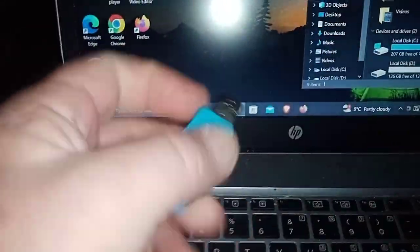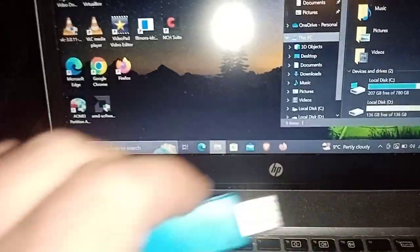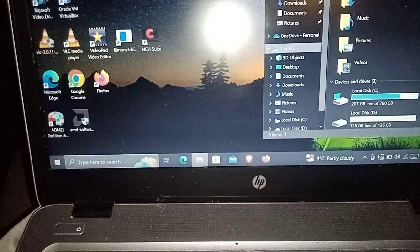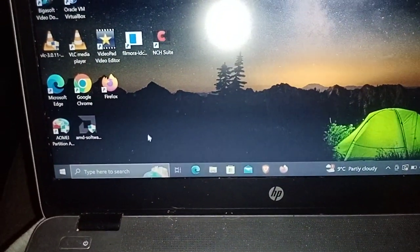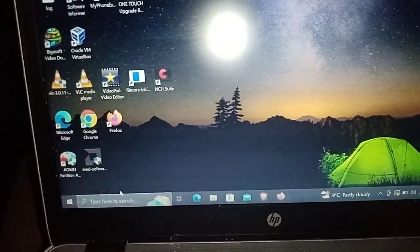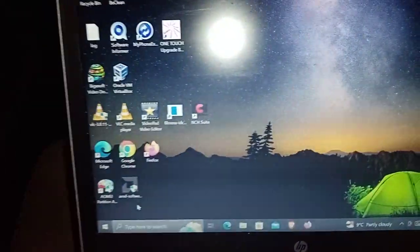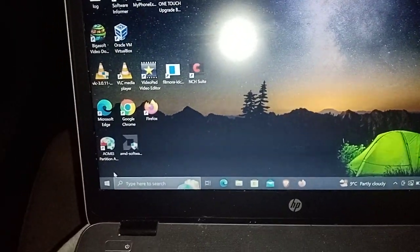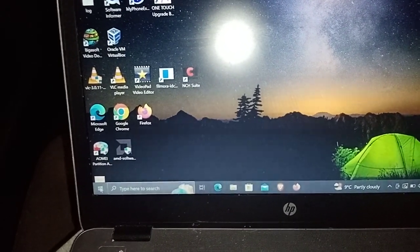Alright, so now, I actually did this one with Rufus this time. I normally like using Ventoy, but anyway, we've got that for the boot. We're going to boot up and press F1 to get in. No, Escape actually, just to get the system menu, to get the boot menu, because we want to boot from this. I can't remember if the boot menu is F12, it might be. Anyway, let's shut off and go into the system BIOS to boot from the USB.